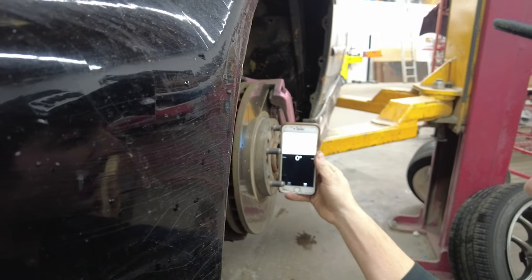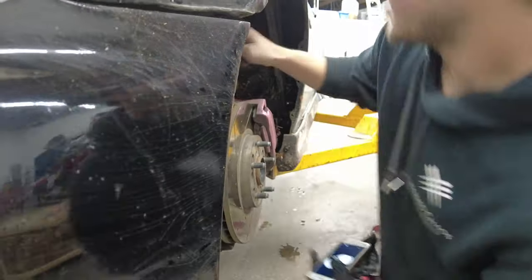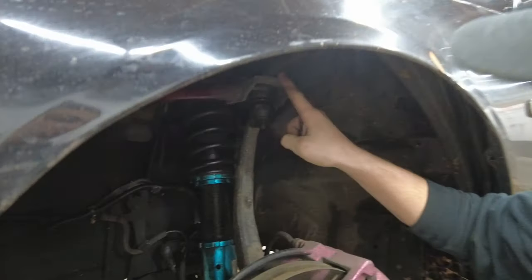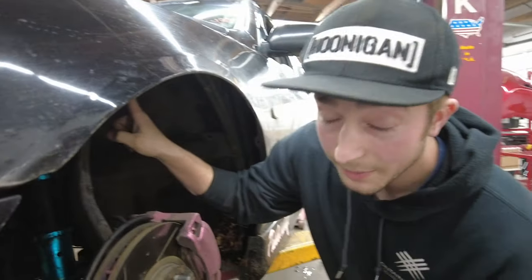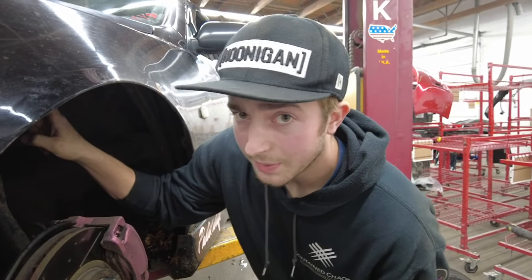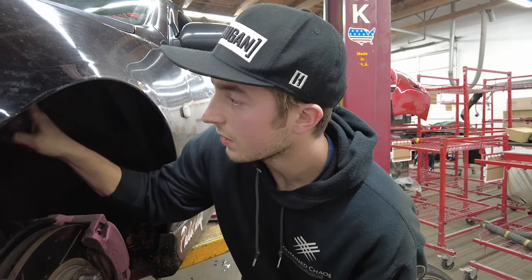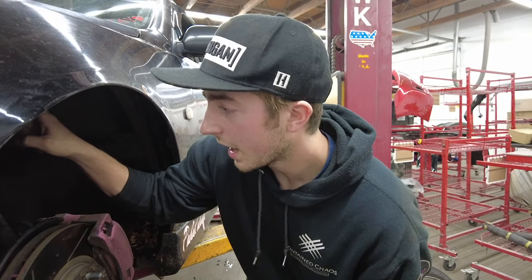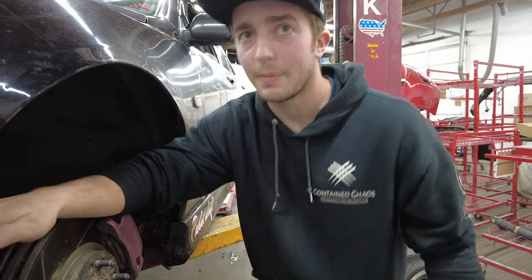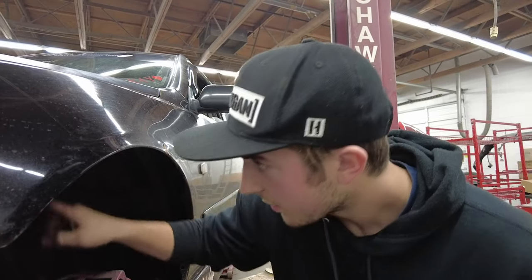So this is sitting at -4 degrees of camber, right? If I wanted to pull camber out, this one has adjustable control arms, you have to buy these. If you're drifting an IS300 and you don't have hella money, get Godspeed arms. I've heard from a lot of reputable people that Megan is literally Godspeed painted blue. And if you hit a curb, it doesn't matter. Sorry for my language. You're gonna crack your arms anyways. Get the cheapest ones you can.